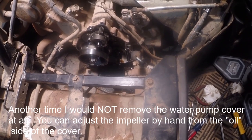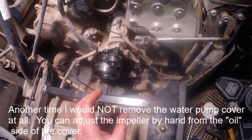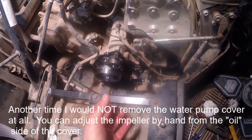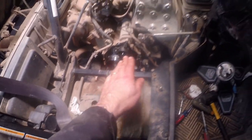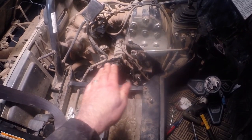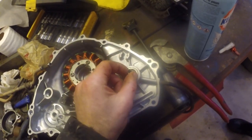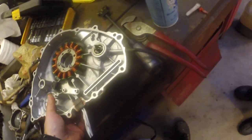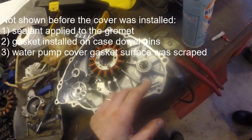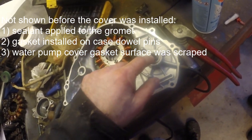The only trick in the manual is there's a shaft that comes out of the oil pump right there and it fits into the water pump impeller. As you're putting the cover on, it helps to rotate the water pump from the outside of the cover ever so slightly. You may get lucky and it just goes on, but look at the orientation of the oil pump shaft and take the water pump impeller and align its shaft, then micro-adjust as needed. If you don't do that, the cover won't fit on properly - something will be interfering. Don't force anything; just try to rotate the water pump impeller and it should snap in place.